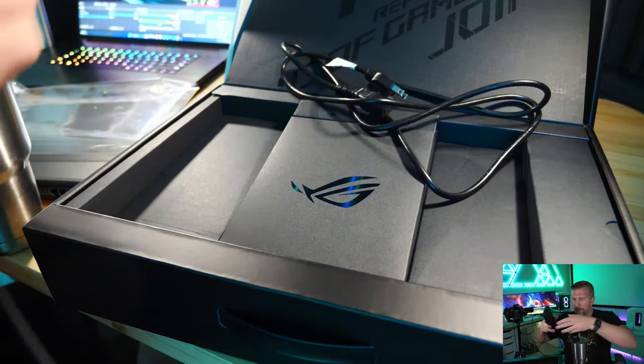Ooh. I'm seeing some interesting juicy bits already. All right, so let's start with the battery. We have a 90 watt hour battery. They did a good job pretty much of utilizing all the space in this laptop, making it as compact as they could. We've got our down firing speakers here. I believe there are also up firing speakers on the left and right of the keyboard. I'm not sure if we're gonna have good spatial audio with this machine, but I don't think we will, most likely. We have our VRMs covered with a dedicated heat pipe here. The exhaust goes out four different exhaust areas, one on the right, one on the left, two along the back here. There is no third fan. It's a two-fan system.